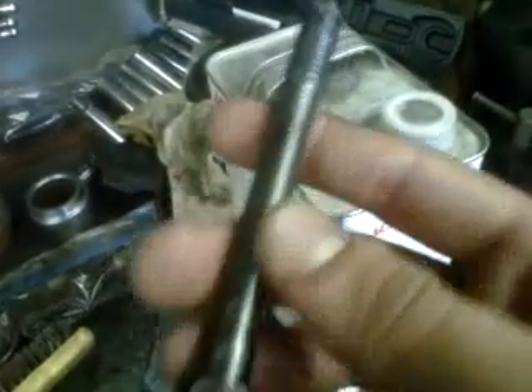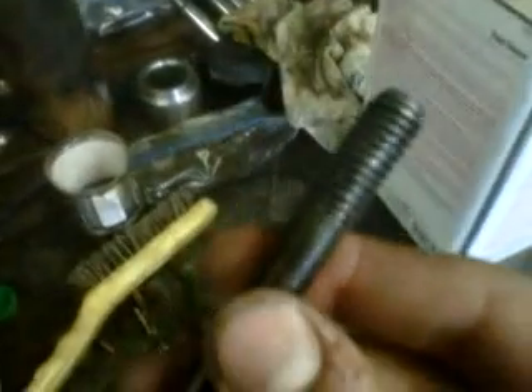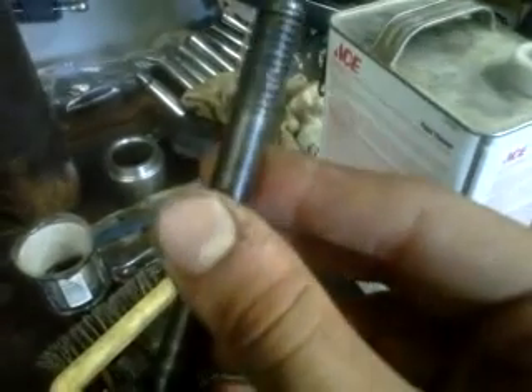You're always better off using new head bolts if it's in your budget, but if it's not, you can use your old head bolts — just make sure all the grit and grime is out of your threads because any dirt in there will have an effect on your torque. If you can help it, get new head bolts, because after these threads have stretched a few times you're better off having new ones.